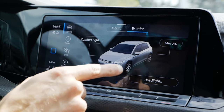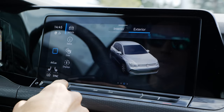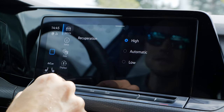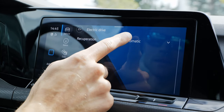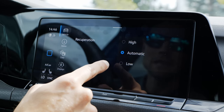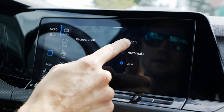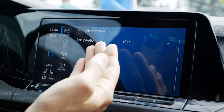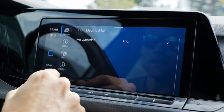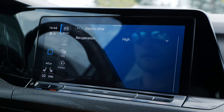In the vehicle menu, you can scroll deep to find electric drive settings where you can set recuperation. Options are automatic — adjusting based on GPS map info — low for a more rolling/coasting feel, or high for more recuperation when you lift the throttle, giving more of an EV driving feeling. We'll leave it on the high setting and experience that in the driving part.